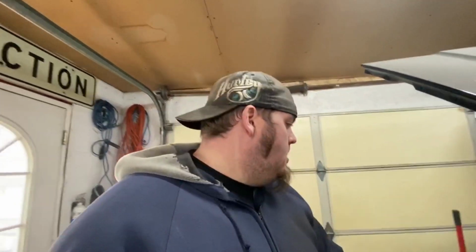So I'm just gonna make sure that that's maxed out, and I'm maxed out into the master cylinder, and there's actually no way, unless something rattles loose, that I will lose brakes or that rod will come out. So I'm going to risk the biscuit for that. We'll see how far that gets me. I'll keep an eye on it for the first little while, see if anything's coming loose or needs adjusting. But that should be just fine. So I'm going to get this thing bolted in.